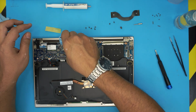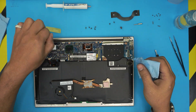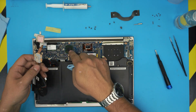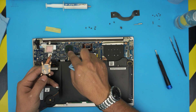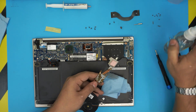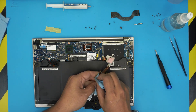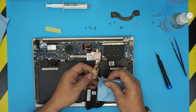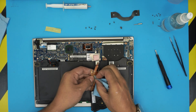There's also a chip called the PCH chip, which handles file transfer and controllers. If you want to replace the thermal pad on this one, it's a 0.4mm thermal pad. However, you don't really need to change it because it doesn't heat up too much — it only goes up to around 40–50°C — so replacing the thermal pad on that one isn't critical.